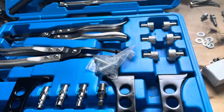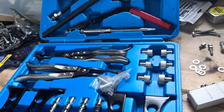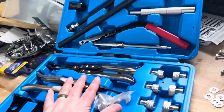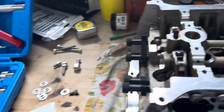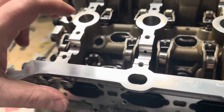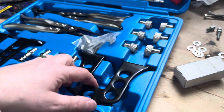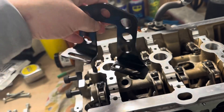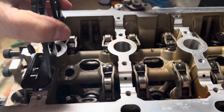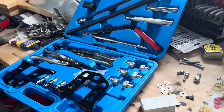Next we're going to talk about this case — it took a while to get from Amazon; I ordered it and they lost it and it came again. This is about a $50-$60 case for compressing the valve springs. The problem is once I drop a new valve spring in, I have to compress it in order to get the top on and then the keepers in place. I'll show you how that's done with these tools — we're essentially going to build our own bolt-down spring compressor. I'll link this kit in the description.